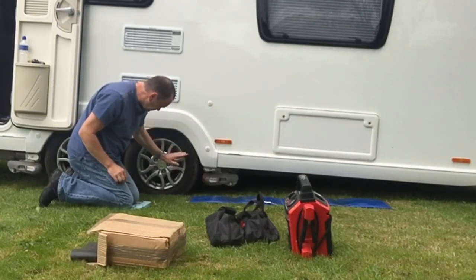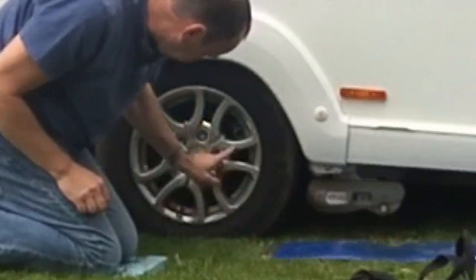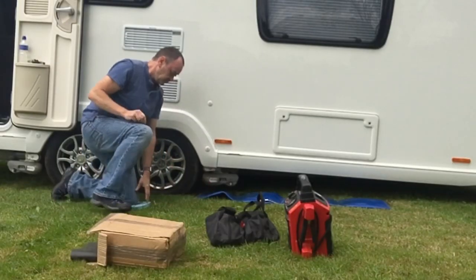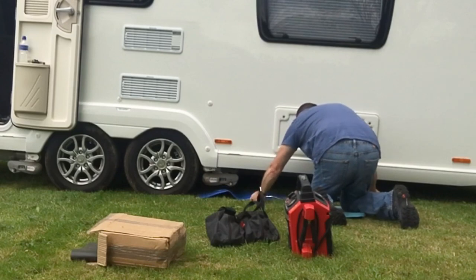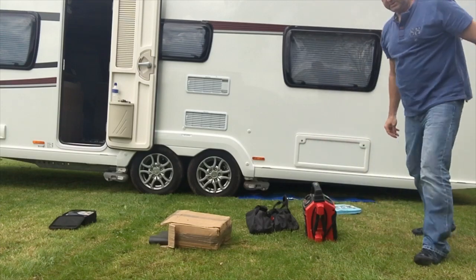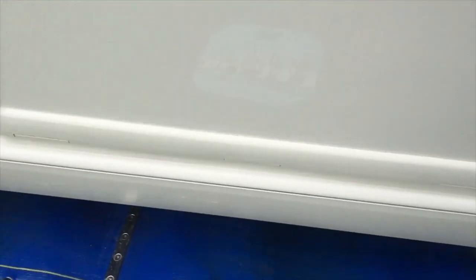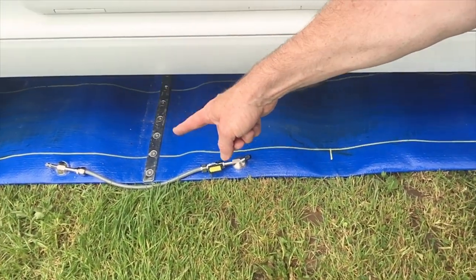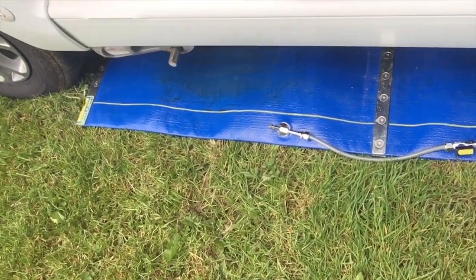What you're supposed to do is wind the caravan back to the position where the rear wheel lock receiver is in position, then slide the Locker Level underneath the back wheel. I can see it only has to go back just a little bit, so I'll put it there as a marker, put it down, and wind the caravan back onto it. The Locker Level has a couple of lines with marks for the middle of the wheel - I want to avoid the middle section where the pump plugs in and keep that yellow line nicely in line with the back wheels.